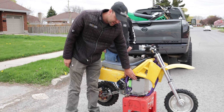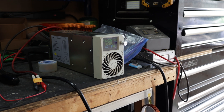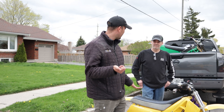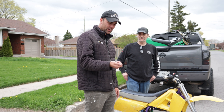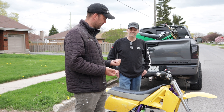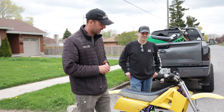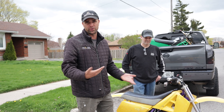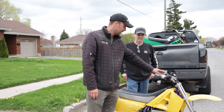Bill custom-built the battery box and put in XT90 charging adapters, then hooked us up with a custom variable charger, which is very common in the e-bike world. You can crank it up to around 1200 watts for a fast charge, or cool it down to as low as two amps for a trickle charge — gentler on the battery. The more amps you cram in, the harder it is on the battery, but it gets you charged faster, which is sometimes necessary at the race.